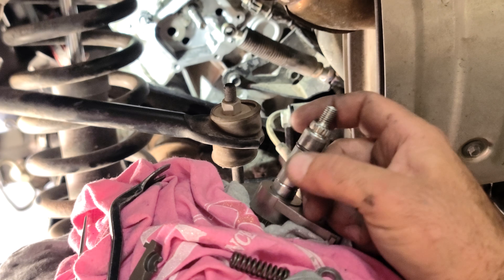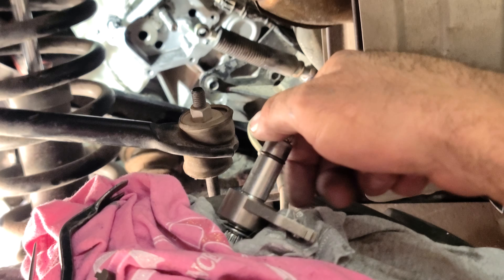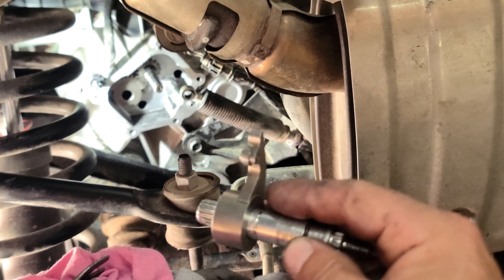If you don't remove the o-ring, lubricate it with a little WD-40 and you can slide it on and off the shaft. You'll then have your new little roller — that's the part that breaks. Slide this in here and find where that notch is. Mine's facing down. Wiggle it into place.